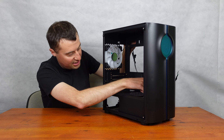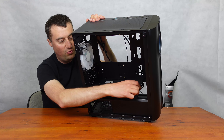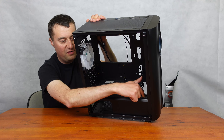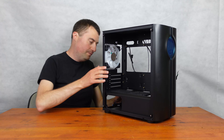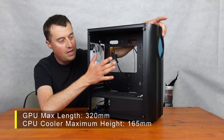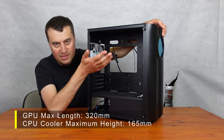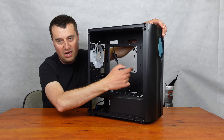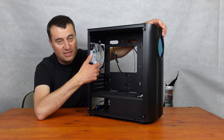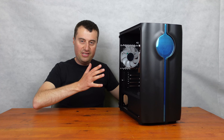There's obviously good cable routing parts here, although with the graphics card, there's nowhere at the bottom of the shroud to put the PCIe cable coming up, so you'd have to route it through this gap, but again it's manageable. The big specs you're probably wanting to know: it's 160mm for the CPU cooler maximum clearance, which is fairly generous — most budget CPU coolers aren't going to get to 160mm, so that should be perfect. And for the graphics card, it's 330mm, or about 13 inches. Plenty of room for a big graphics card. I really do think CIT have done quite an exceptional job to get this package in for £35.